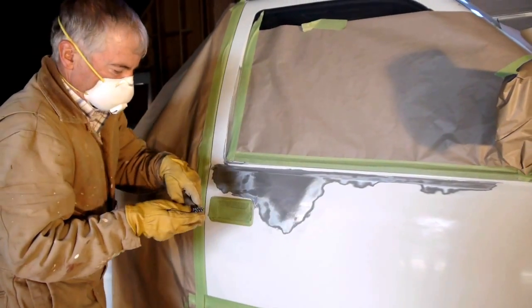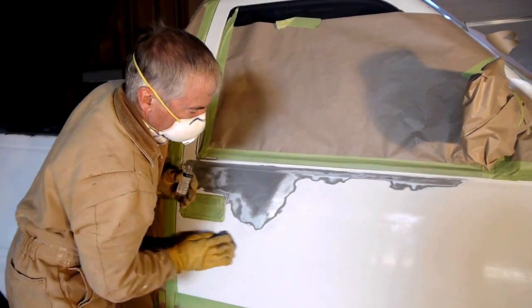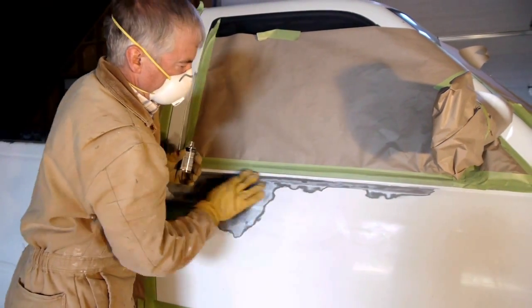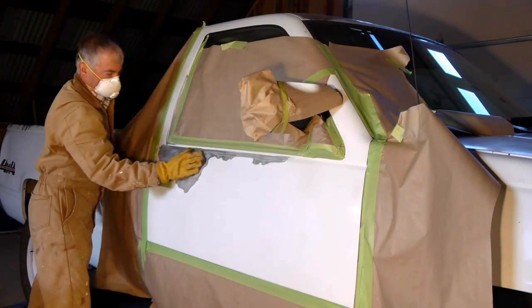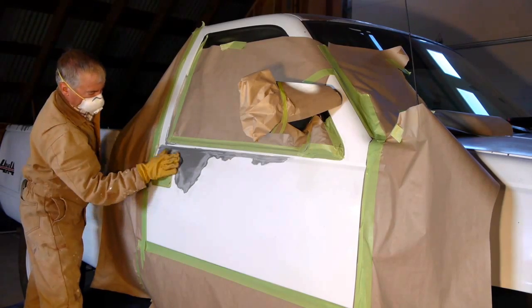Third, clean the area. Apply our paintscratch.com wax and grease remover with a clean rag and thoroughly wipe the scratch and surrounding area. If you don't clean the area, the touch-up paint won't adhere properly. After the area is clean, wipe it down with a tack rag just before painting. This will remove any dust or debris, allowing the paint to adhere properly.